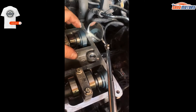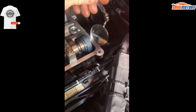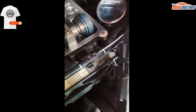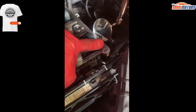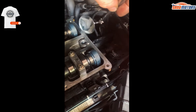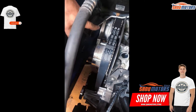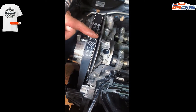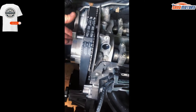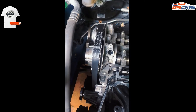What I do is use a mirror — with the mirror you can see the slots clearly. That line has to be horizontal, but with a good light and a good mirror you can see perfectly where the highest points on either end are, and they have to be exactly spot on, both sides. While they're all loose — if you're just doing the cam belt you don't have to loosen them up; you can just mark them or lock up with this tool and it will lock up anyway.